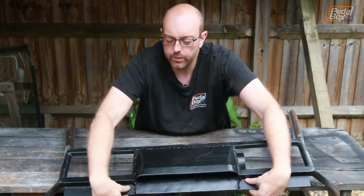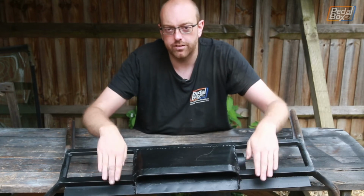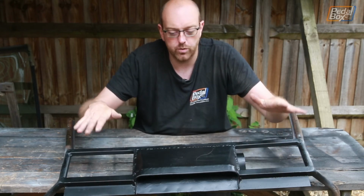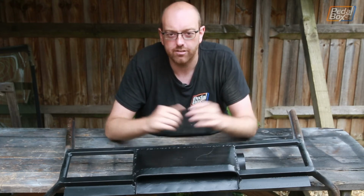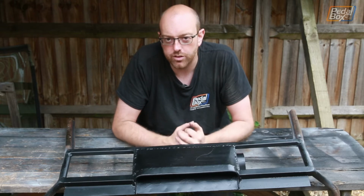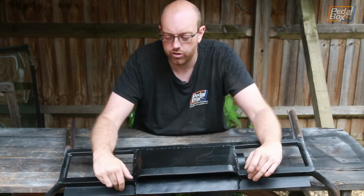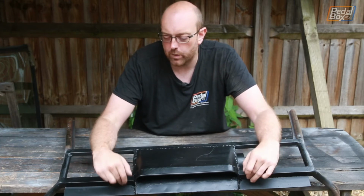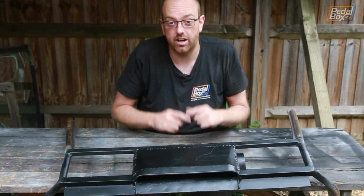I've also added this 2-inch lip across the front, which is going to be the forward edge of the roof structure to take whatever we do with the roof. Now, there's a little part of me in the back of my mind that says I'd like to have a removable roof if I absolutely could. And even if I don't do that, I'm still going to need something to attach the rest of the roof onto at the front. So this went in now because it's a lot easier to weld in the underside of this while it's off the car than when it's on.